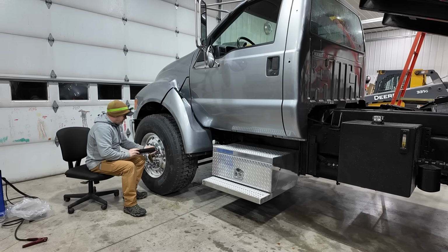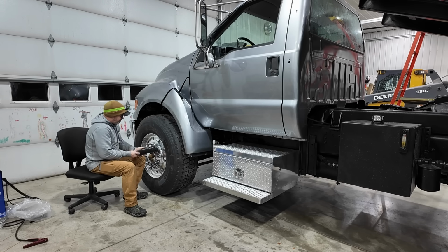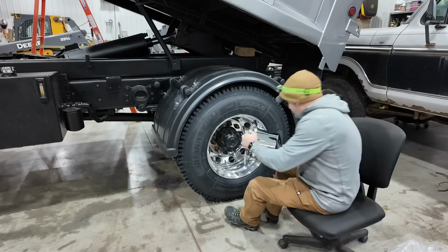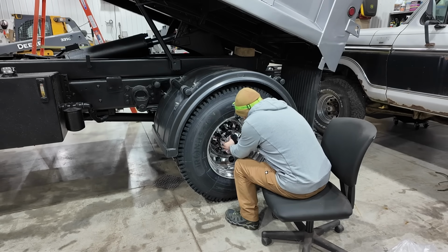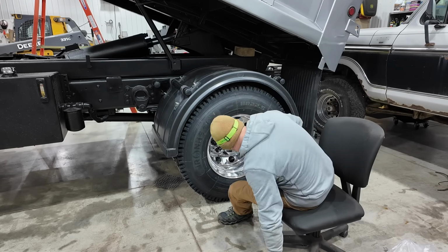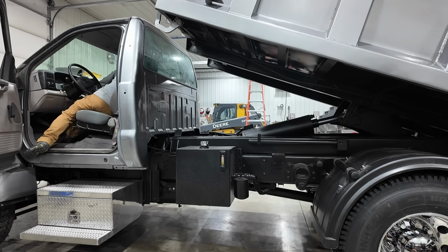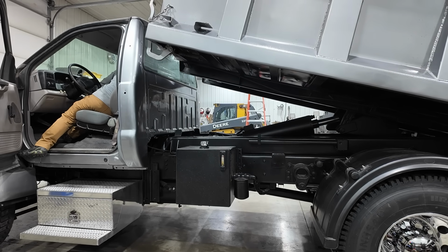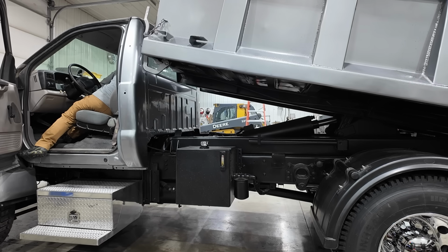All right, well, I spent an embarrassing amount of time trying to find that ground fault. And if I hadn't just been down underneath yanking on the wires, I wouldn't have discovered that that bolt had been actually rusted off in the frame. Anyway, that was my problem. It was a ground problem. We kind of knew it was, but it took 2 full days for me to discover it. And I tore everything apart in the process that I didn't need to, but that's the way it goes.